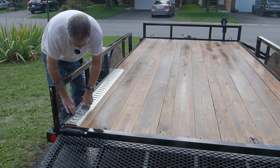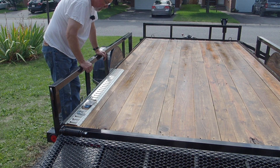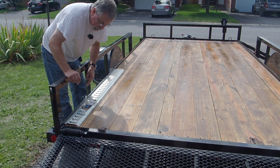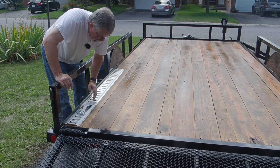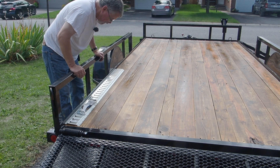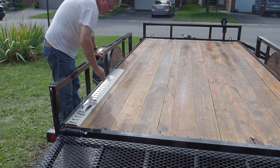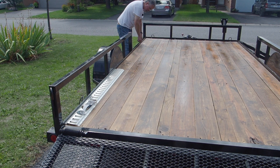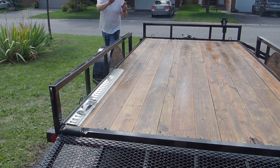We want to bolt through the structural members as much as possible. I'm going to use large fender washers. Since everything is structural underneath, I'm going to bolt in four different spots across here. My force is going laterally, so I'm bolted down solid with two solid points to the frame. I'm going to use four quarter-inch bolts per side — eight per track — one track here and one up further in. I've also got a couple of places to tie down on the inside, and then the same thing on the other side.